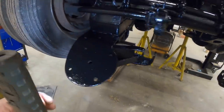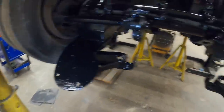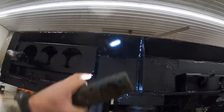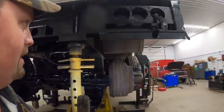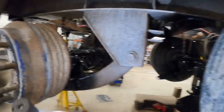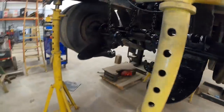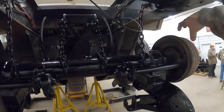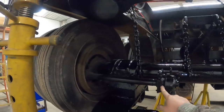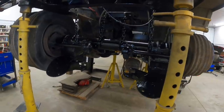Today is about the next step. Kevin actually painted where all the old airbags were - we cleaned those all up and painted them, put some primer on those. The back of his trailer's light bar was rusted out - I replaced that, welded it up, that's all in the previous video. Unfortunately I didn't get any action shots of Kevin touching all that stuff up. What we're going to work on is getting these u-bolts replaced. We popped one out here - you can see it's all rusted inside these pockets. We're concerned about those holding, because the way this axle sits on top, whenever it's loaded it's holding all the weight of the load. Then we'll make sure all these slack adjusters are working, shafts are turning, before we start putting on all the new airbags, brake chambers and all that stuff.